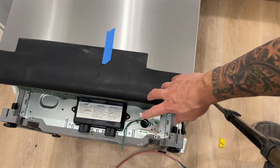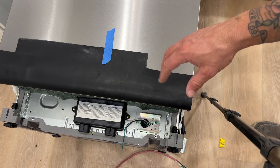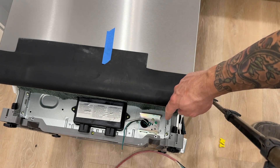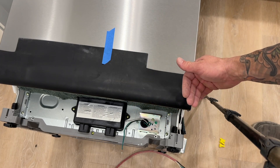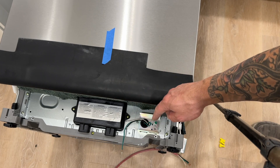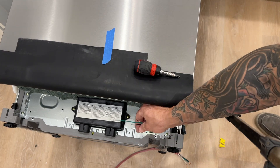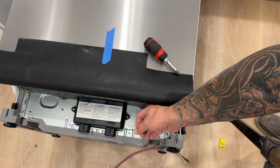When I was looking at the instructions, it said to look on the left side for a panel to remove. I looked all the way around — a lot of these new dishwashers are completely enclosed plastic and there was no panel. As I started inspecting it I found it on the front behind a flap on the right side, which even on the side it says 'right' — so the instructions are wrong, but I found it. You remove a small cover with a single screw and behind it you'll have three wires: black, white, and green. White is neutral, black is hot, and green is your ground.